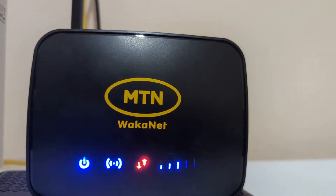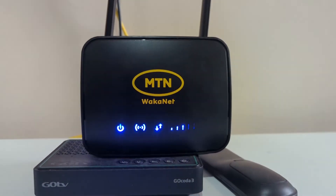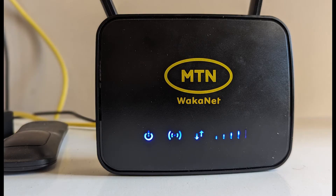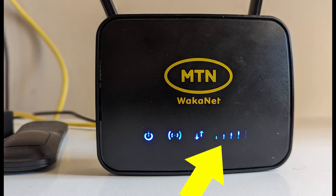Now the router will start up in a few seconds. As I explained in the unboxing video, this is the power button. If it's blinking, for routers that have inbuilt batteries, this means the battery is charging. If it stops blinking, that means the battery is full, or power isn't plugged in. Then we have the Wi-Fi light, which shows Wi-Fi is being broadcasted. We have the LTE light here — if it's red, it means no network is being accessed or SIM card is not inserted. Then we have the network signal light here, which shows the strength of the network you're connected to.